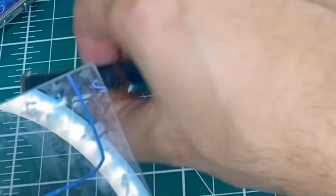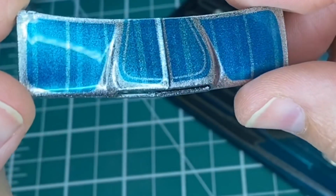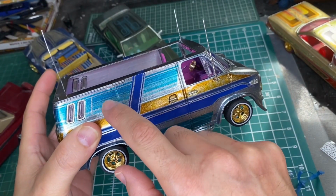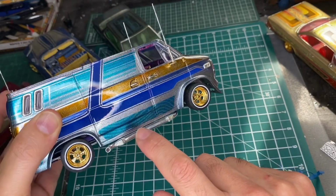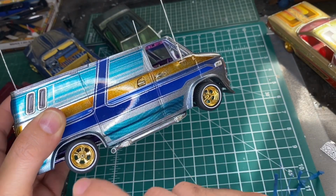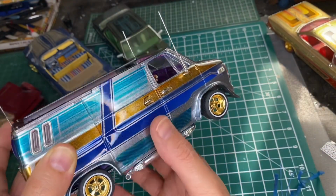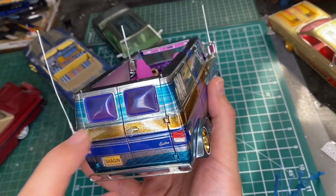So looking at that, if you look at the hood again, you can kind of see how that's been achieved, right? Pretty straightforward, pretty good effect. Then you can see on the van, I've also done it on the side at the top, and that's in a more gradient style. So I'd spray everything and then remove the lower pieces of masking. Then on the bottom, I've laid out a pattern, sprayed the candy, and then I've removed the pattern of masking and sprayed the candy again. And so you've got those two steps of candy gradients.